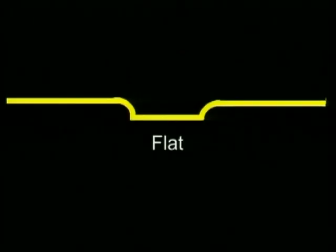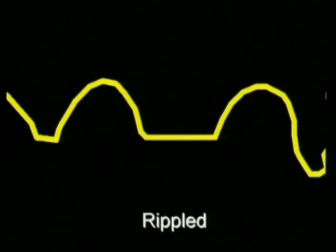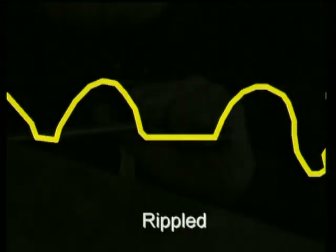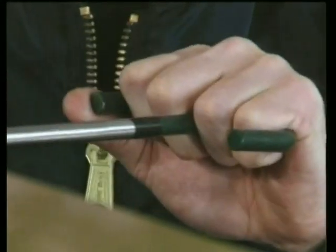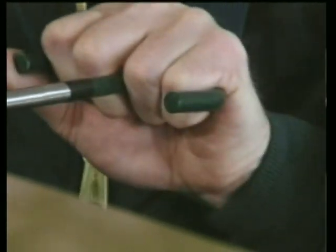A flat is seen in cross section as a smooth flat area at the bottom of the dent. Flats are usually created if you start working the dent from the middle rather than the edges. A surface has been rippled when the metal has lost its flex, which can be caused by taking out micro highs and lows too many times in the same area. The metal becomes hardened and there is not much you can do except bring it as level as you can with the body panel using fine grit paper, polishing it — and not charging for it. Therefore it is easy to see that avoiding the use of excessive force is so important. Equally important is accuracy with placing the tip.